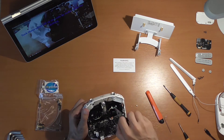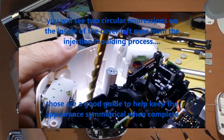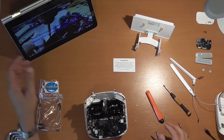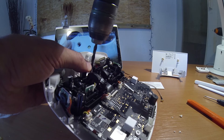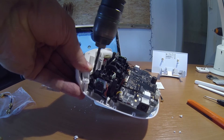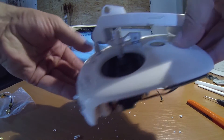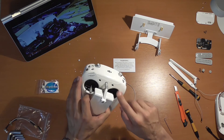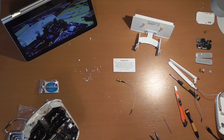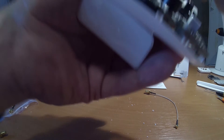I'm going to pull and use the scissors. It will pop out. You need to try a couple of times and in different directions put the pressure, but then it will come out. So we're going to do some drilling. You will see two circular impressions on the inside of the cover left over from the injection molding. I can see that — just get rid of all the rubbish. They say that these tiny pieces of plastic can jam the joystick if they're still in here, so you want to make sure they're all gone.